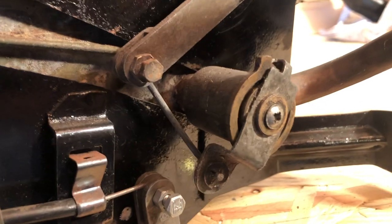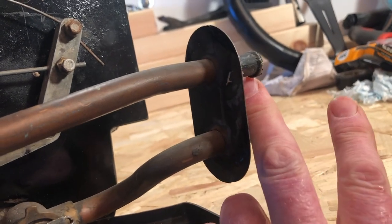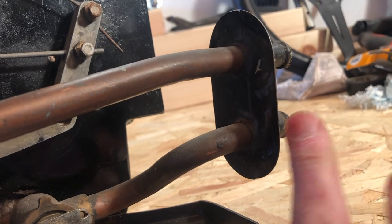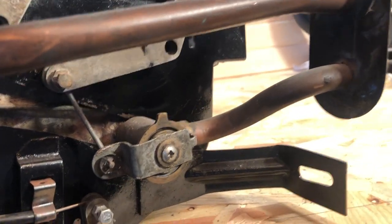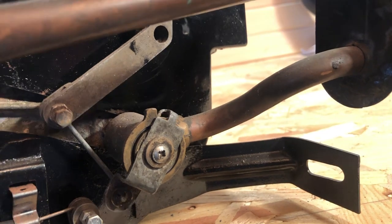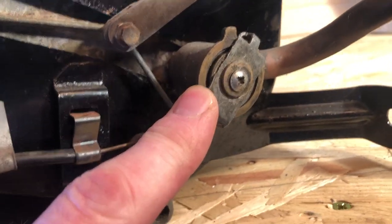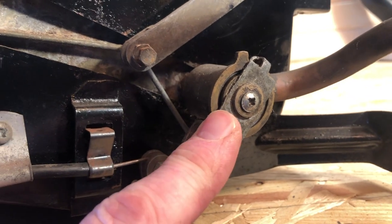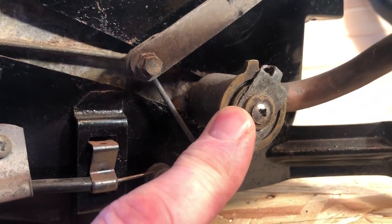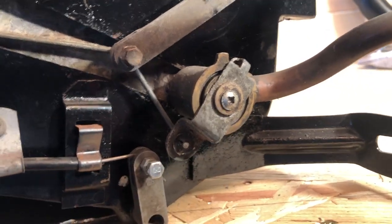When it reads cold, I'm opening the valve to let the hot water in through. At the top you can see the bulkhead connection — this feeds into the top of the hoses that go to the engine, so you've got a hot feed that comes in and allows water to flow through or not depending on whether you've opened or shut that lever. The body of the valve is a brass body which you can remove and replace — these get stuck a lot, either corroded or clogged, but I'll do a separate video on that with Stephen Bradbury's films.